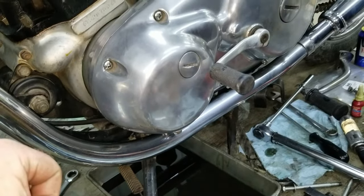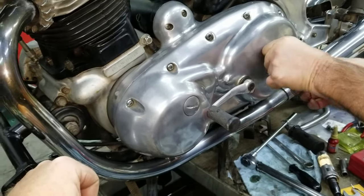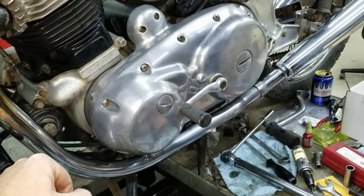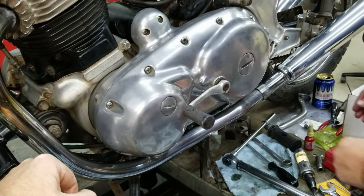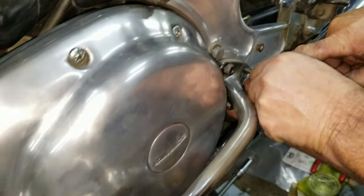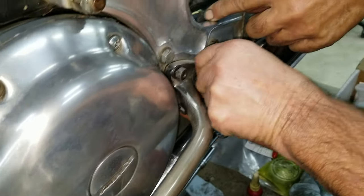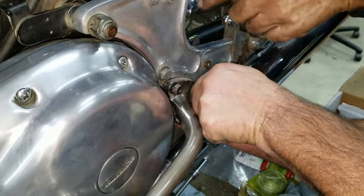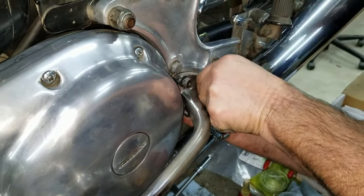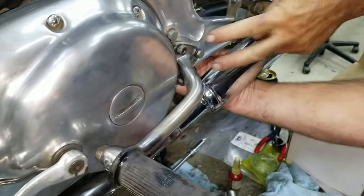Yeah. Yep. Right, and that tightened down, we might fire it up and see if it runs, starts. Should start. On a Mark III, this bolt back here threads all the way through and catches a ground wire, because the Mark III has a Zener diode on both sides. So it has to have a ground on there. So they put a long bolt on each one of these, because on the old Mark IIs, there's three studs.